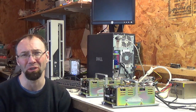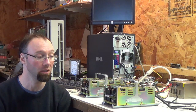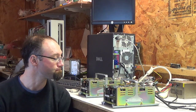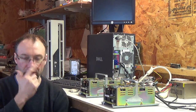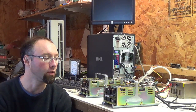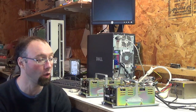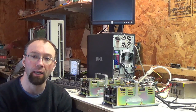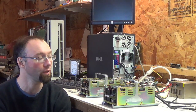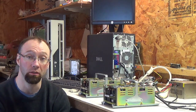One disc I got 500 megs worth before it started throwing errors everywhere, so I'll probably have another crack at that at some point, but 15 discs all up. The remaining 9 discs, not so much. Somebody had suggested that, for God's sakes, he hoped that I had tried to send the start command to the discs, which makes copious sense, except that firstly the discs were jumpered to start on power-on, and secondly the controllers never came on the bus. Without the controller coming on the bus, you can't tell the controller to start. So I'm assuming, I believe, I hope, I think, that the controllers are fragged.